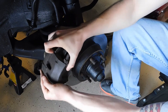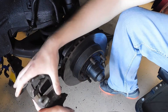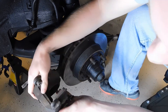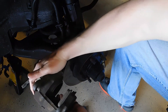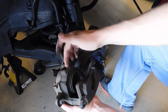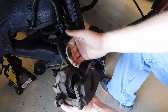To remove the caliper you just simply pull it out. Here you have your brake line that goes to the caliper, and your brake pads sit in here. On the back of the caliper you can see one large piston. On the piston you will have a dust seal to keep contaminants out, and on the inside you will have a square-cut seal.